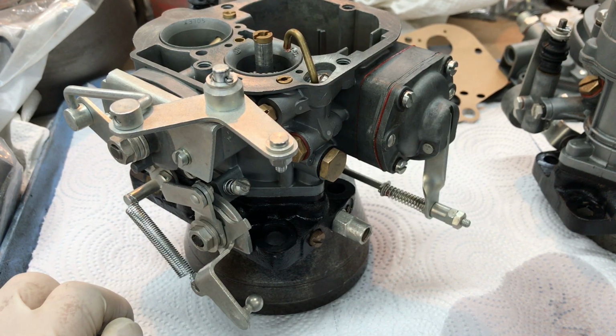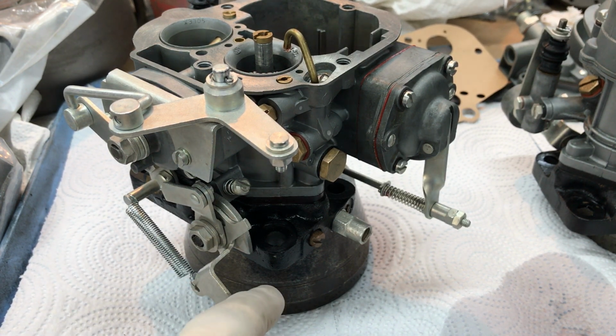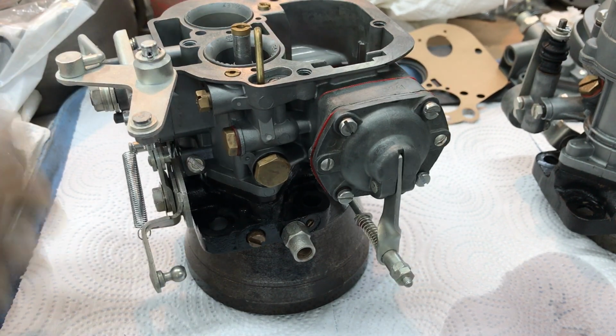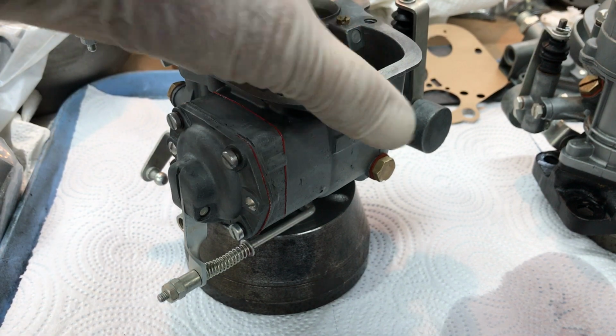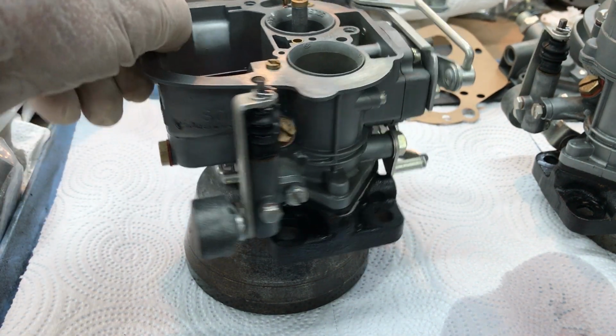I'm trying to think what else. I think that covers it. Got new balls here, so your linkage will be as tight as possible. Make sure your sockets on your end are nice and snug. Put a little ATF on them for lubrication. That's about it.